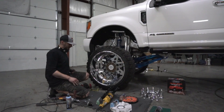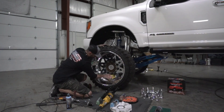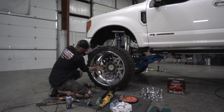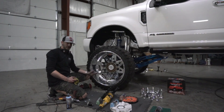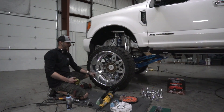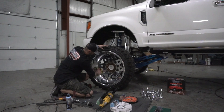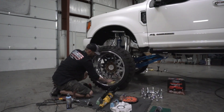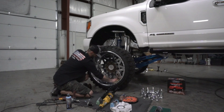When you get all the way back, before you go to your next step, grab your rag with mineral spirits on it, wipe everything back down again including the holes — kind of thin out that polish a little bit so it's not as hard to wipe off. Go ahead and get every little bit of the wheel that you've touched. Down inside here, all the way around — nice thin layer, let it dry up. The reason why we do this: one is to clean off the compound, another is to kind of leave a cheat sheet. It's going to leave a layer of film behind, so as you're going, it's going to clean off the film and leave a perfectly polished surface behind it. That way you can see exactly where you're at — if you skip over a piece, you know you have a little film behind it and you can back up and adjust.